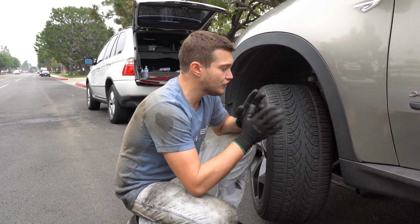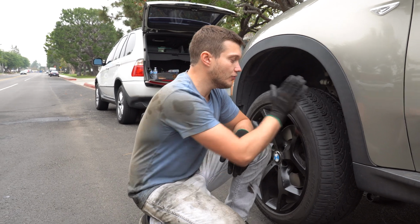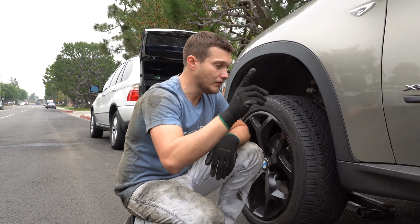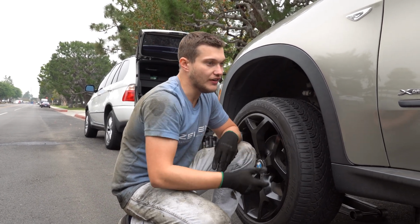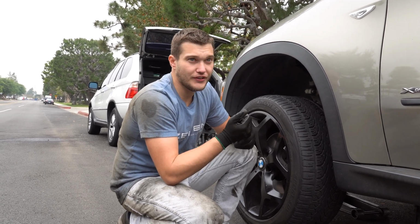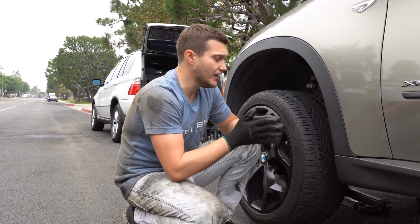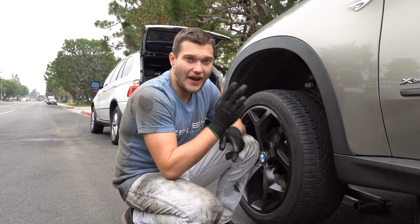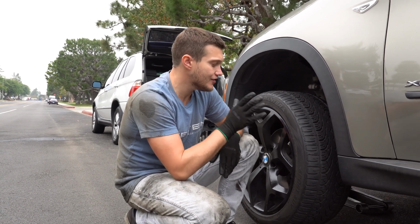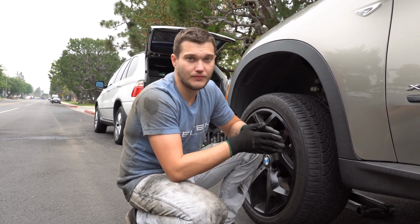After brake pad replacement in the front, if you do all four or just the front, what you've got to do is replace the front pads, pump the brakes, I'll show you how right now, and then replace the back brakes. This way you can save some fluid, and there's less chance of getting air in the system, even though the chance of getting air in is really critically low. When you change the brake pads, you don't have to bleed the brake system. You don't have to change the fluid. You don't have to do anything else. Just this. If someone tells you otherwise, that's not true.